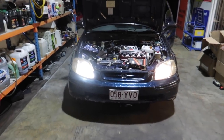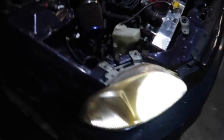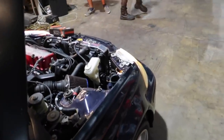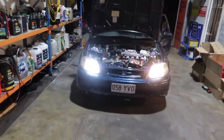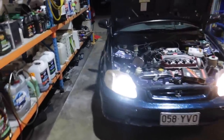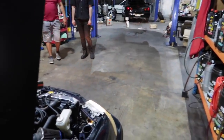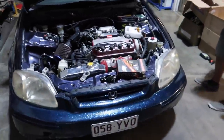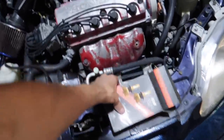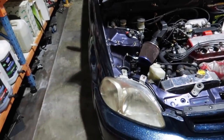Oh wow, there's a huge difference. There's a pretty big difference. And then I think this has high beam kind of built into them as well — the LED high beam function as well. That's a pretty big difference. Look at that brightness difference. That's a pretty big difference, and it's like proper white too. Yeah, I'm happy with that. We'll switch out the other one now. There you go — comparison of these cheap LED lights. There's only $19 for this kit. It's a bit fiddly to get the H4 little spring brackets in behind the coolers and stuff, but you can get it after a bit of time. It's just a bit fiddly and you need a fine screwdriver and a lot of light to get in there.